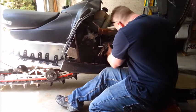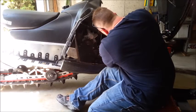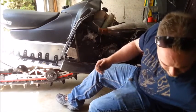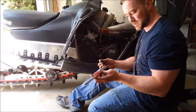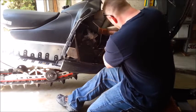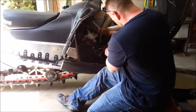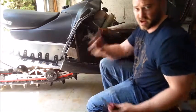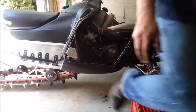So this just goes back in here, and we're going to manipulate this radiator hose every which way. This just kind of sits on there and you bolt it back together. I'm going to run one of the top ones as a pilot bolt first since it's real easy to get to, then go around and tighten all the other ones down. I actually recommend using one of these gear drivers — it's probably the best thing for it. I've tried three different techniques here and don't know why I never thought of this before. I'm not tightening this all the way yet — I still want to be able to shift it around to get the other ones in place. I want to get them all started before I tighten any of them down.